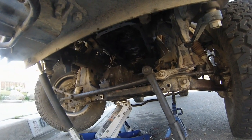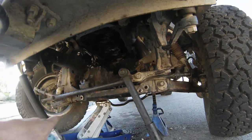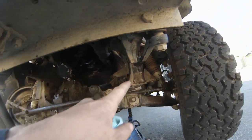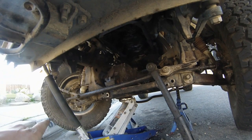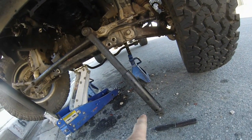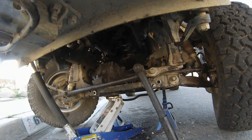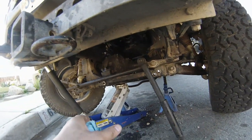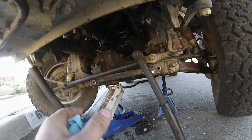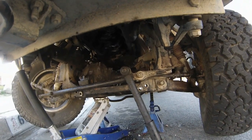To avoid that, you have to take off the front crossmember. What I had to do was remove the pitman and the idler, and then remove that crossmember and the stabilizer, whatever the hell that is. That's how I was able to get it out through the front. If I had lowered the diff more, I could have gotten it out through the back, but the diff wasn't going to lower, so I had to come out through the front. And yeah, that's where I'm at right now.